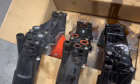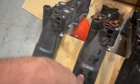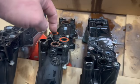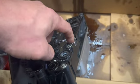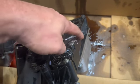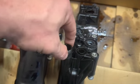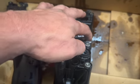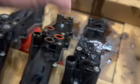Here are a couple of kits — a little variation here. These two are pretty much the same from the old Chrysler logo. But notice this one that actually came out of a Jeep — it's a little different. See all this pink stuff? This one was actually leaking coolant, not oil. Most of the time we see oil on these, but down in that engine bay there was about a half inch of crystallized coolant all the way around this thing. You can see the gaskets are gone and the O-ring is gone, but with all of this buildup I couldn't make a clear decision that it was just the seals — this stuff is all over the place and it looks like it comes apart at one point, so I decided to put a whole new cooler in for this gentleman.